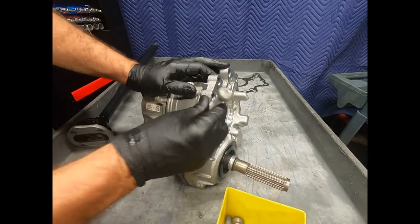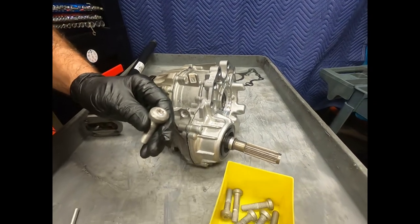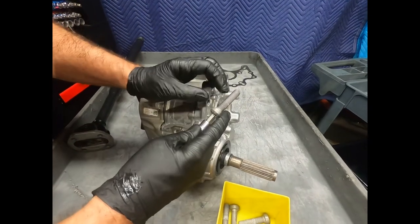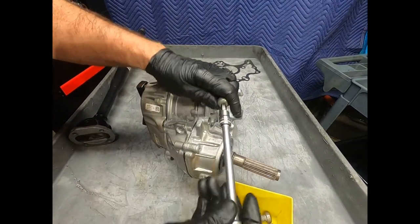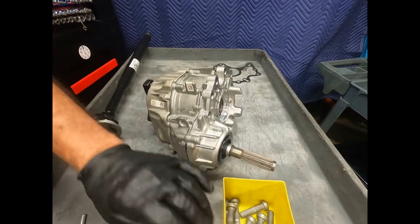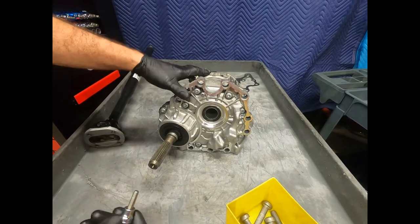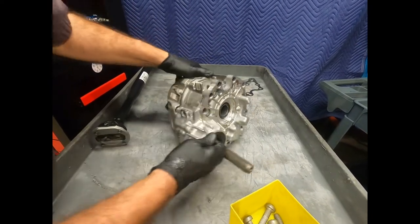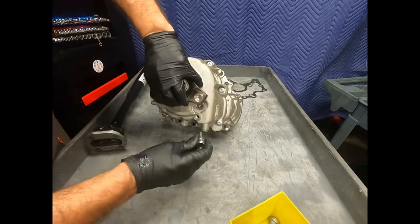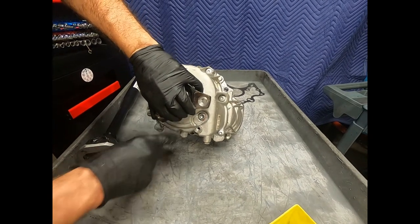When removing these, be careful. The torque is not excessive. These are actually T-50, and they all came loose without any problem using just a conventional 3/8-inch ratchet. We'll go ahead and tear it down and take a look at the design of this later 4Matic unit. Here we see the drain plug and there the fill plug.